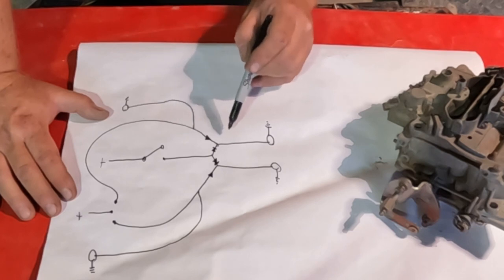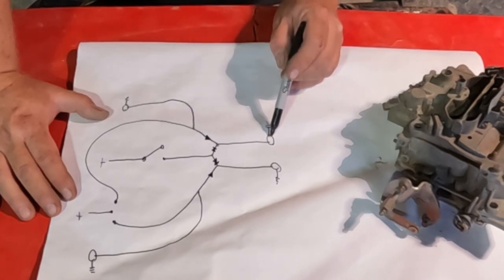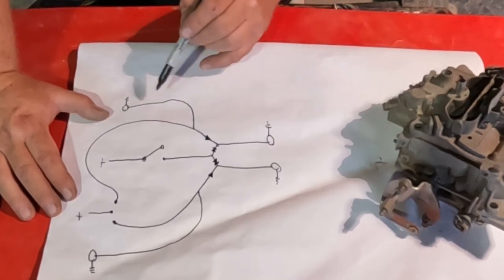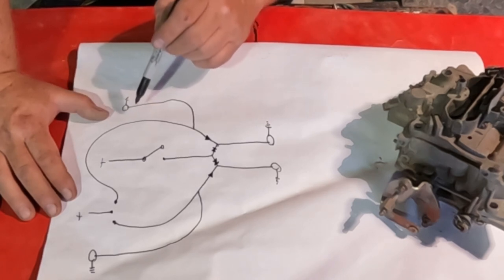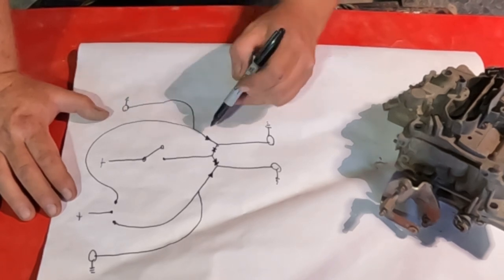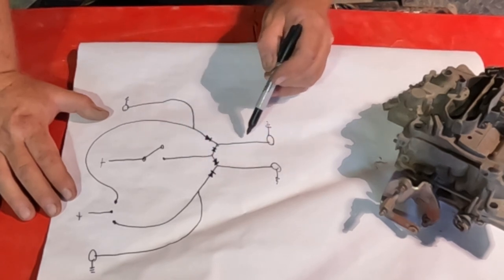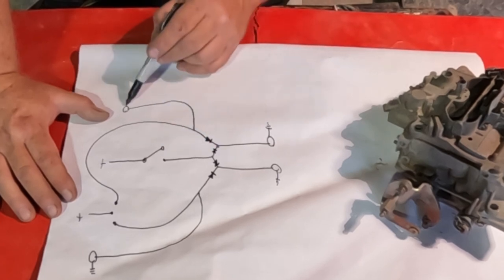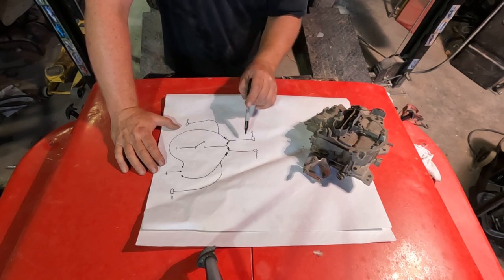Now, if I have this free flowing, I can go ahead and power up my individual signal lights, but if I hit the brakes, it'll power up both lights and both front signal lights. So the front signal lights would be brakes also, and I don't want that. So I need another diode in here to prevent this from backflowing from the brake light circuit back to the front signal lights. By putting a couple diodes in here, making the electricity only go one way, I can make all the lights work the way I want.